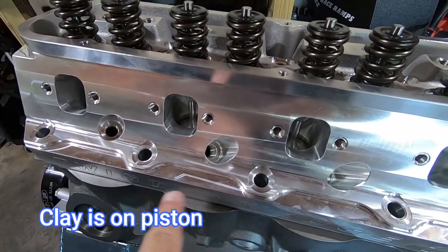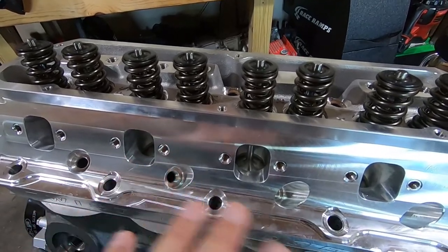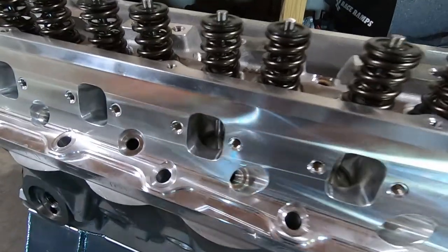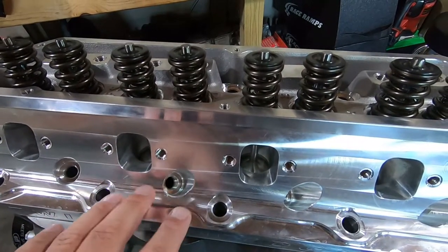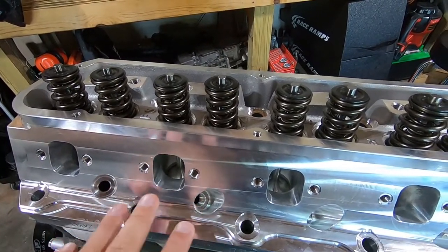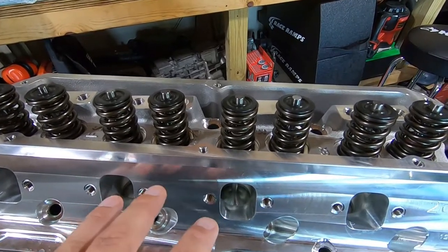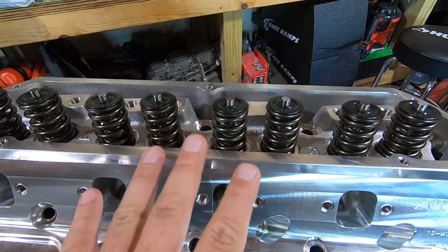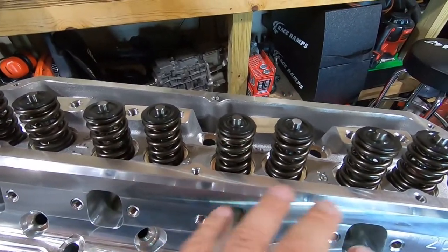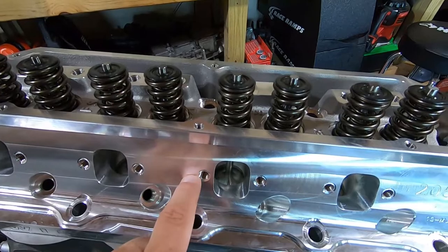For temporary purposes I have a 1011 head gasket under here and I'm just gonna cinch this cylinder head down hand tight — it doesn't need to be compressed all the way. This is the proper way to install cylinder heads if you're going to use studs. You want to mount the head first without the studs installed, because if the studs are already in the block and you lay the head down, chances are you're not going to get it just right the first go around. You might end up resting the head on the stud and moving it around, which mars up the perfectly finished face on the cylinder head.